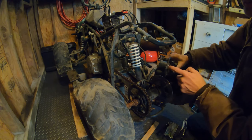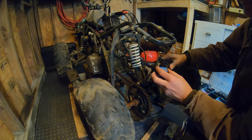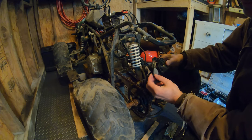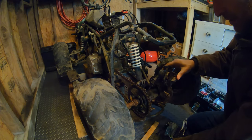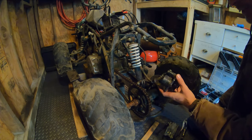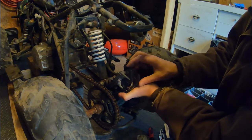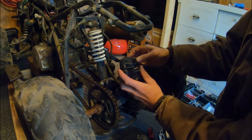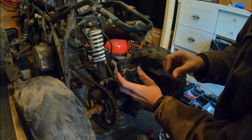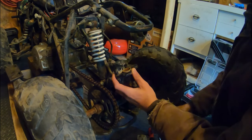So I need to get the pot here far enough back so this other pad can sit in this recess — it literally just goes in there and settles down in. This one was just neglected for so long that the pad just fell out. To get the other one out, you go at an angle, get one side to slide, then swing it and lift it out. You won't be able to do both at the same time, but you should be able to shimmy one and then swing and get it.